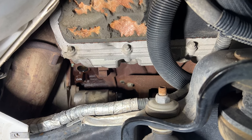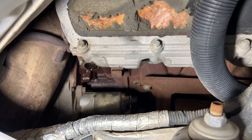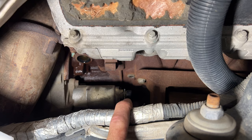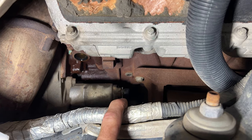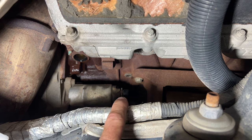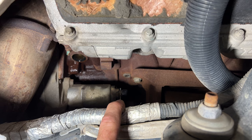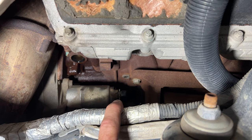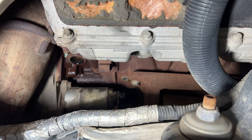As I got my plastic trash bag out of the way, I guess I lied — there is a block drain plug right there that I did not see. So we probably didn't have to remove that. Looks like it's going to be a 3/8 Allen head, but there's no way of getting a socket or anything on there because the starter is somewhat in the way. Before I go ahead and try anything, I want to go ahead and disconnect the batteries so I don't arc on the starter. So let's go ahead and do that.